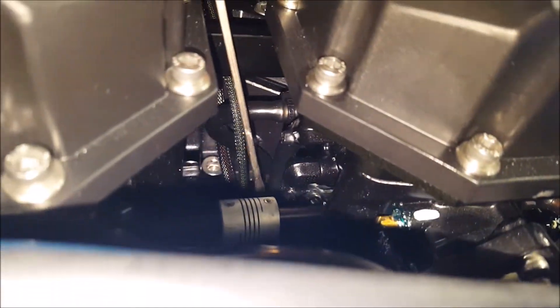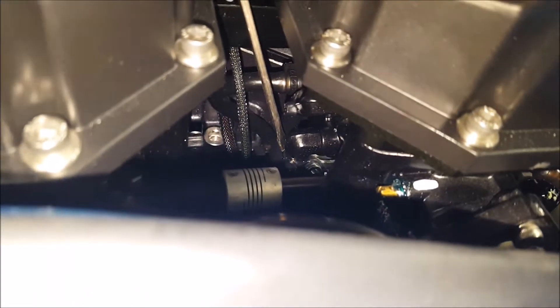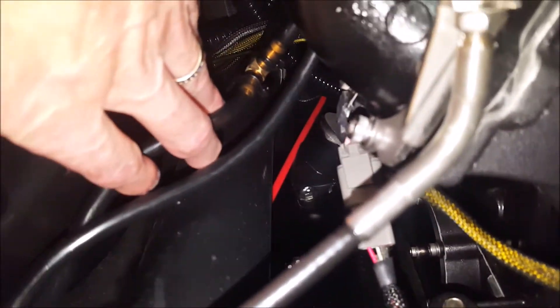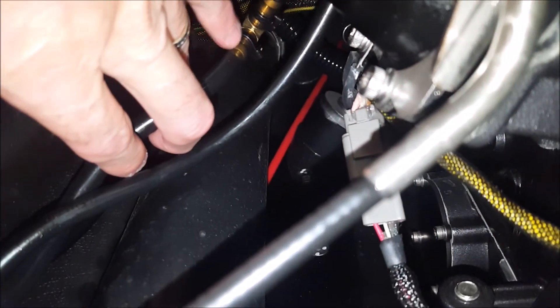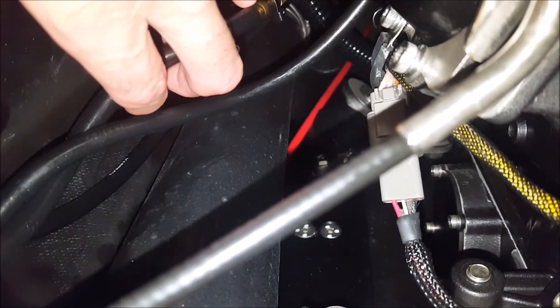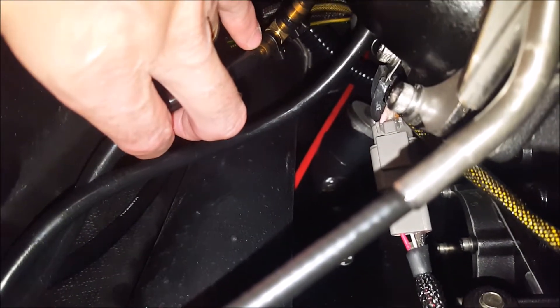The inlet lines coming off here are going to go into the lowest fitting on the carburetor — right down here. That's going to be your inlet on both carburetors. The top fitting up here is going to be your return line. It's important to note that in the return line there is a T, and inside that T, right on this very edge, is a jet. Both lines are forced to come down through this T and through this jet, which helps keep pressure inside the carbs, and then the remaining fuel goes back into the tank.